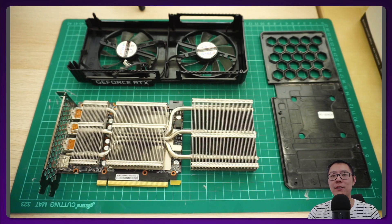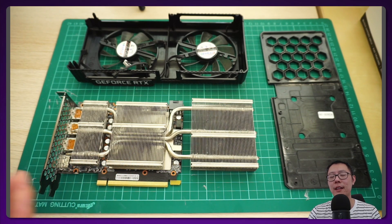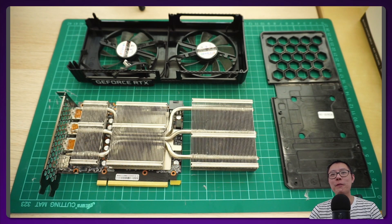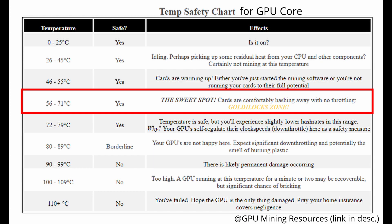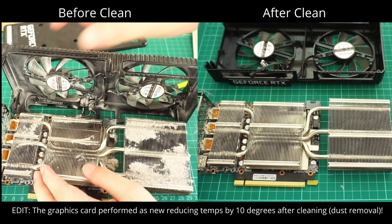Initially I wanted to change out the thermal pads on the memory because I thought the GPU core was getting a bit hot. It's all tied to the same heat sink, so if the GPU core gets hot, the memory gets hot too — memory usually runs about 20 degrees hotter than the GPU core. I was getting about 60–64°C on the GPU core, but I incorrectly read a table; it's actually 70°C where it starts getting hot, so 60–64°C is perfectly fine. I've also cleaned a lot of dust off the card, which should help temperatures.